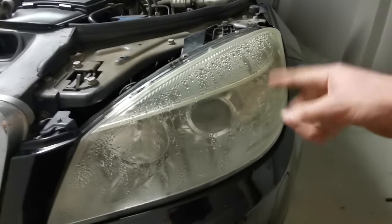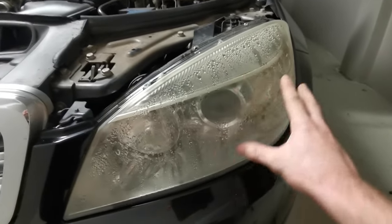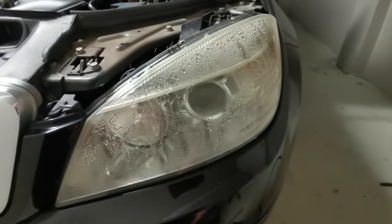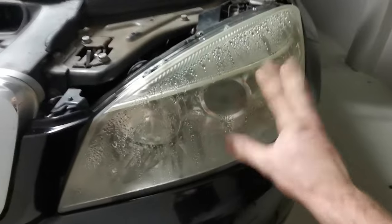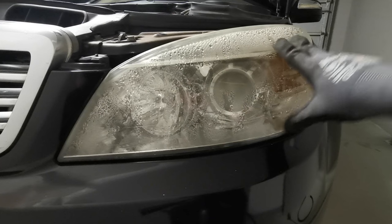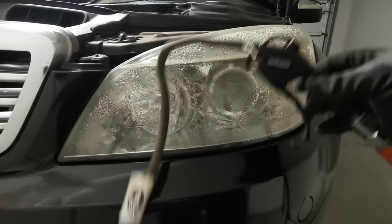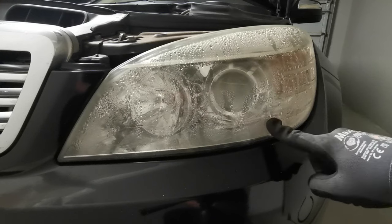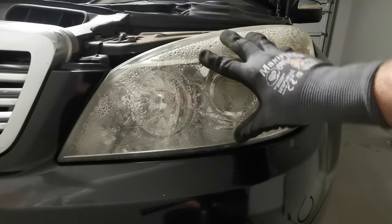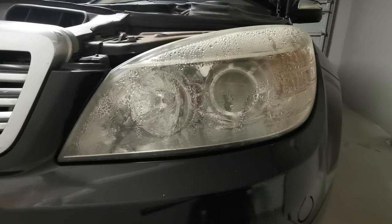I'm going to set this up now — insert the pipe in the back, take one of the headlight bulbs out, then apply some vacuum and some hot air on the front, and you will see how easy this starts to absorb and clean out all of that. It's the same as using a dehumidifier in your house. What I have is my air blow-off gun onto a piece of pipe. I'm going to remove the indicator bulb here, allow the tubing in, and start blowing air inside while I apply heat with a hairdryer.